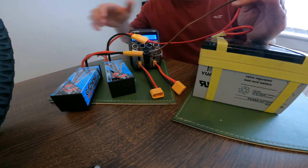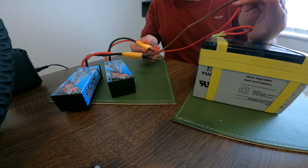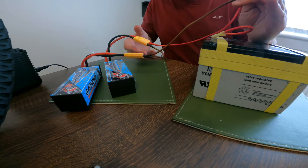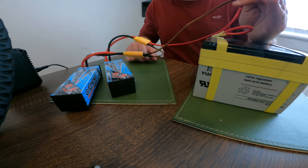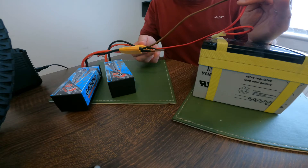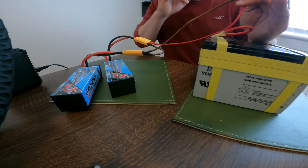You'll need to make up a wiring harness to connect this to the OSET 12.5. It's quite simple. You can use any type of connector you want. I'm using the XT90s — it doesn't really matter what you use. This is what I use for all my kids' RC cars and that, so I've just stuck to that. A bit of basic soldering skills, but you'll find loads of that on the internet. Dead simple, dead easy to do.